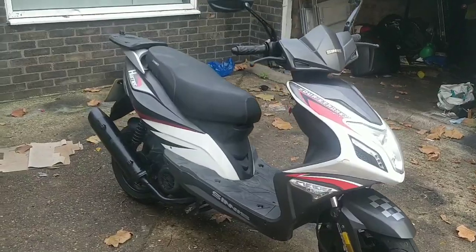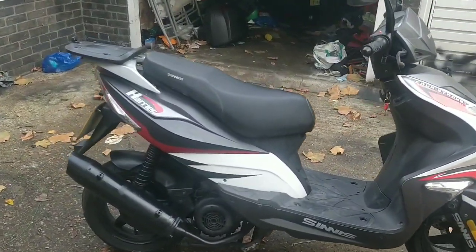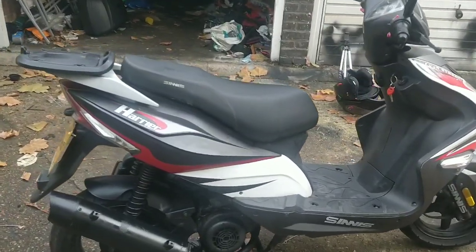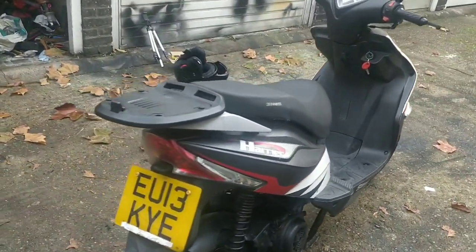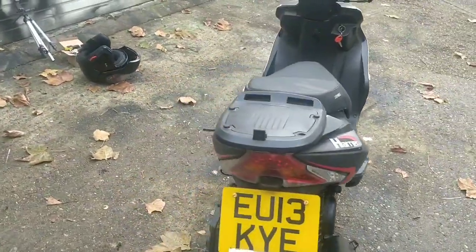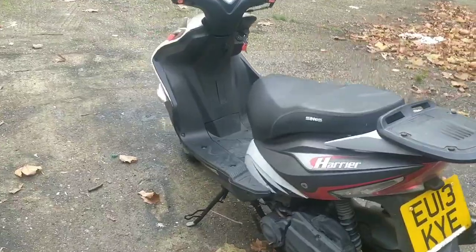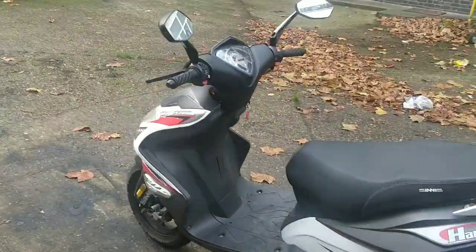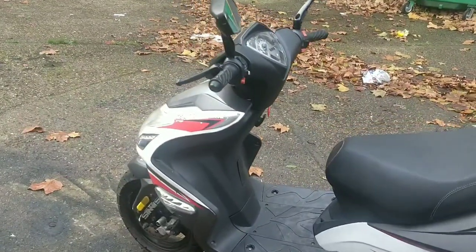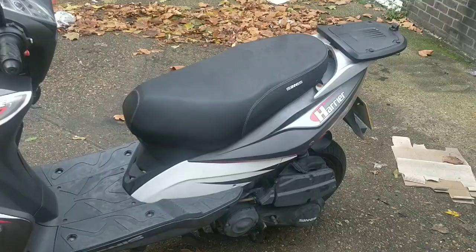But I'm also aware that it cut out and you didn't really get to see this bike in its full glory. So the bike, I believe, is ready and MOT-able. Starts, runs and rides absolutely beautifully. When me and John test rode it yesterday evening, the headstock was slightly loose and rattly, so we took all these top panels back off and nipped that up again, and we're left with a bike that's pretty cool and kind of ready to go.